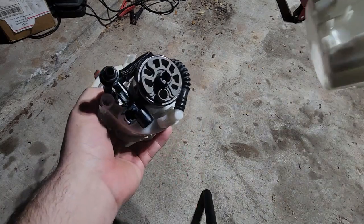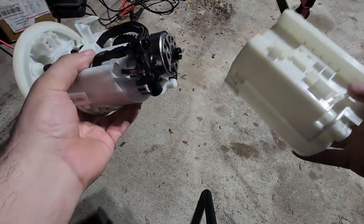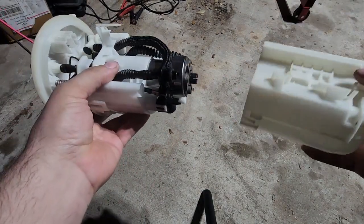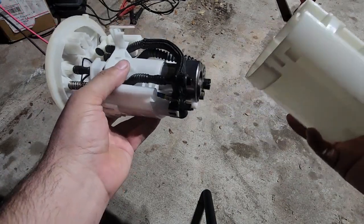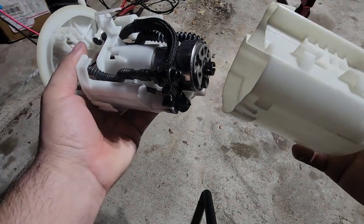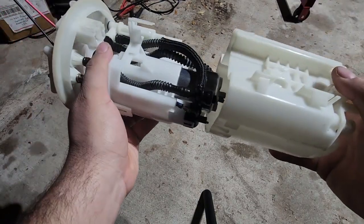So it's not recommended for everyone, but in my case, I am running to a point where my 340 is starting to run out of steam. Even though it's hardwired, I'm starting to lose fuel pressure towards the higher RPM on E85 only. So this is something I want to try, and let's see how it works out.